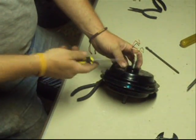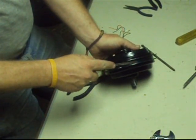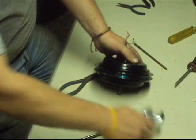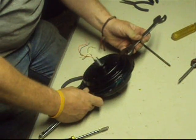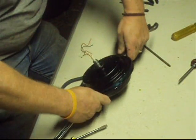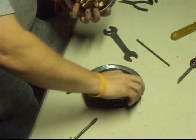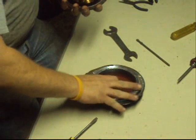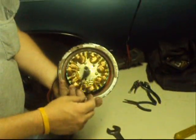This is the one with the ring but that's okay — we want to see this side and we'll still be able to do that here in a minute. The only thing we really have to worry about is this needs to leave. That will be on this cover when it comes off. We have a little bit wider implements of destruction — I think it's about ready to just fall off on its own. And that will do it just fine. This is a cover to your bearing down here — you might want to keep it. It fits up against that little snap ring, which we'll leave on here. Now we just want to get the other side off.